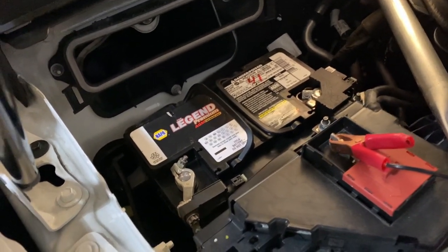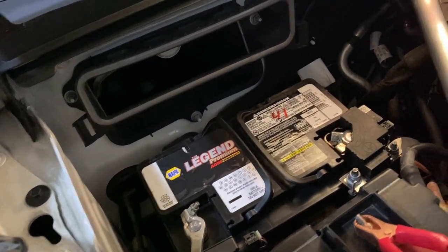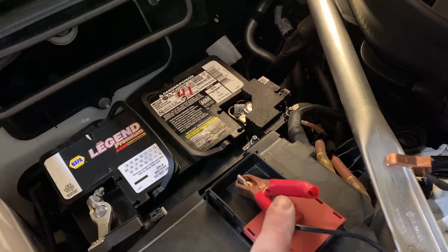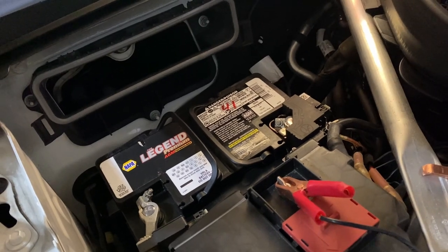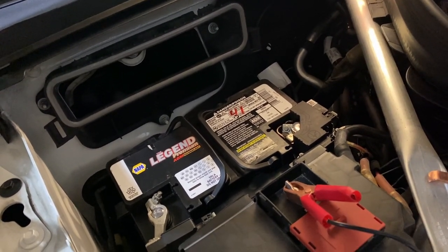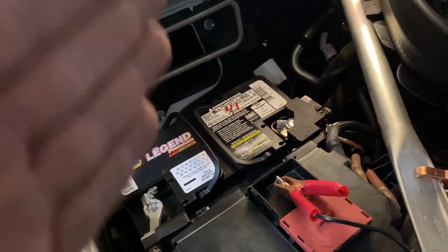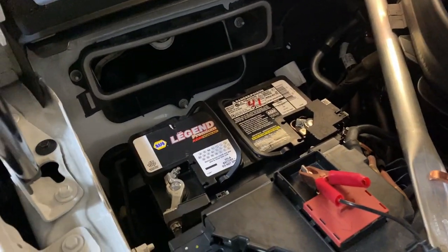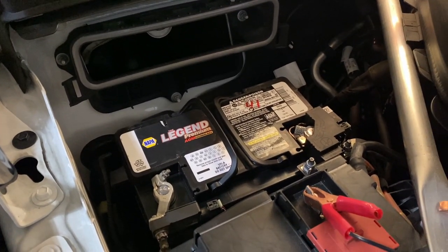Don't do what I did. I had the new battery in the trunk of this car, and with the battery unhooked — even with the trickle charger on — I was not able to open the trunk, nor was I able to fold down the rear seats. So I had to go in the back, sit on the rear seat, lift the battery up over the rear seat and out through the back door. Take the battery out of the trunk before you start. Learn from my mistake.